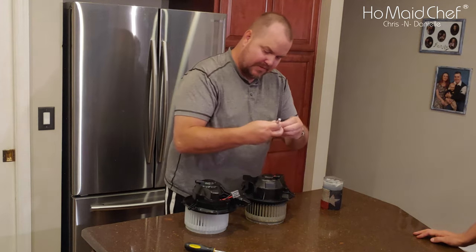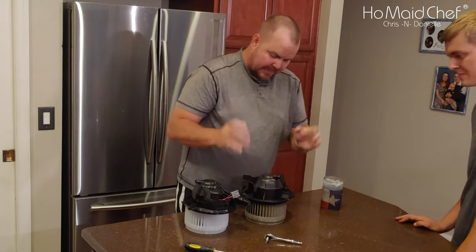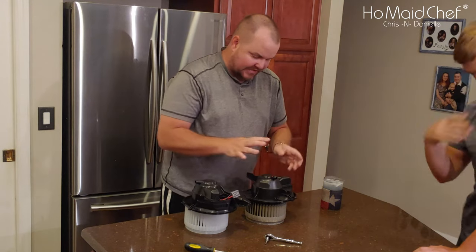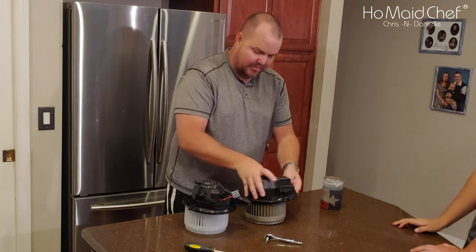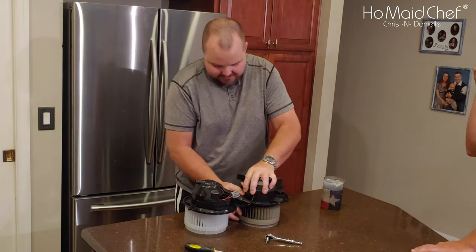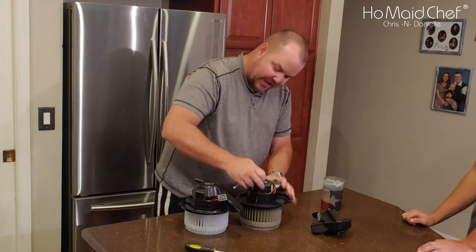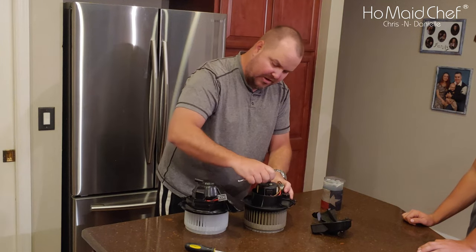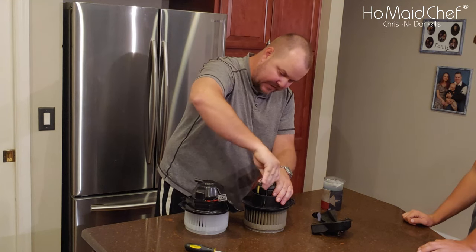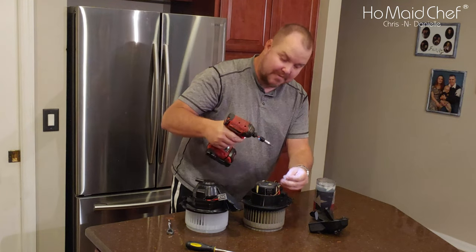What is this? This is a T20. When you get your new fan blower motor, it doesn't come with the resistor. So you have to take that off. You have to pull this thing off and then take out these T20 screws. An impact is much faster.